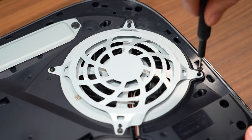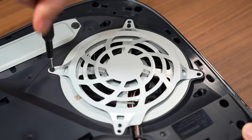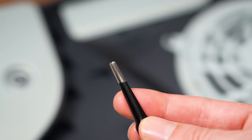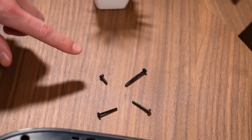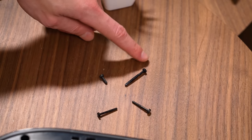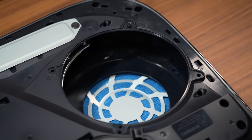The most challenging part is going to be the cooling fan itself. You will need a Torx T8 screwdriver to take the screws out, and I would recommend using a pair of tong tweezers to disconnect the fan from the terminal. A quick tip: keep track of which screws go where because they are various different lengths and it can get confusing when doing this for the first time.